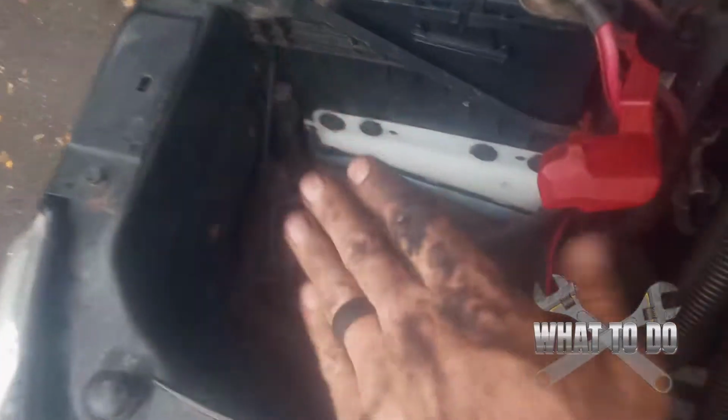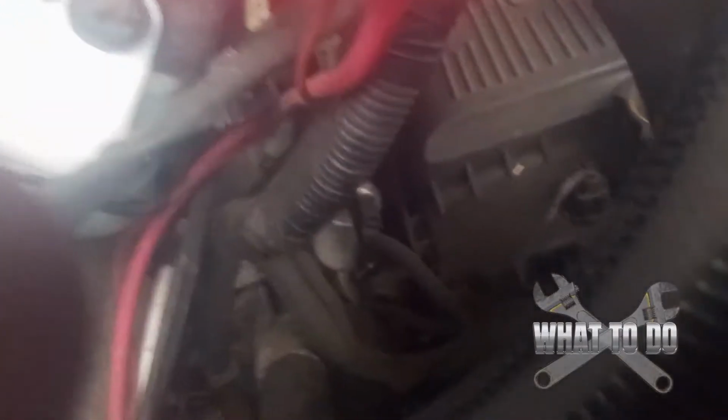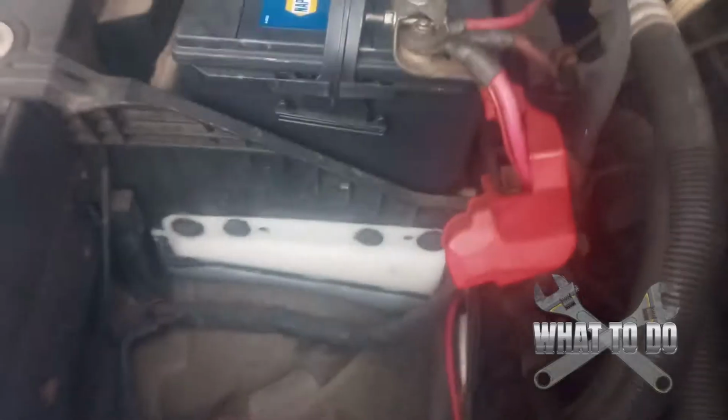When you're putting that tensioner pulley back on, you're really going to need to lower your head down in this space, and you probably can't see it from here. No, because it's buried in there. Well, you can see the nice shiny chrome. That's the new tensioner pulley. But what you're going to have to do is get your hand down in here and get the far left bolt in first with your fingers. And I'll show you with the other one on the bench.